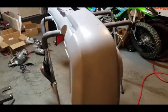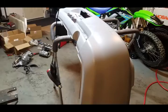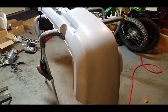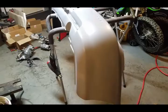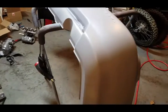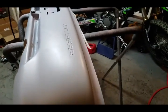Just got the first coat of primer on. I've been taking a heat gun to it — it's like 30 to 35 degrees and I'm spraying waterborne primer, so the weather really affects it. There's no hardener in this; it's straight from the gallon. I'm gonna keep doing the heat gun for the next 20 minutes, let it sit another 20 minutes, then do a second coat.